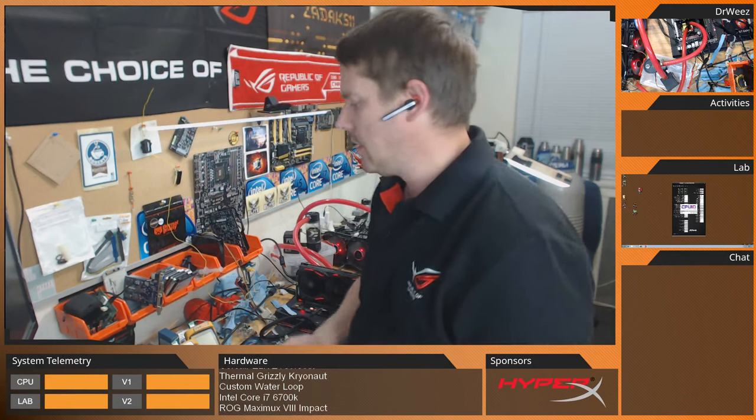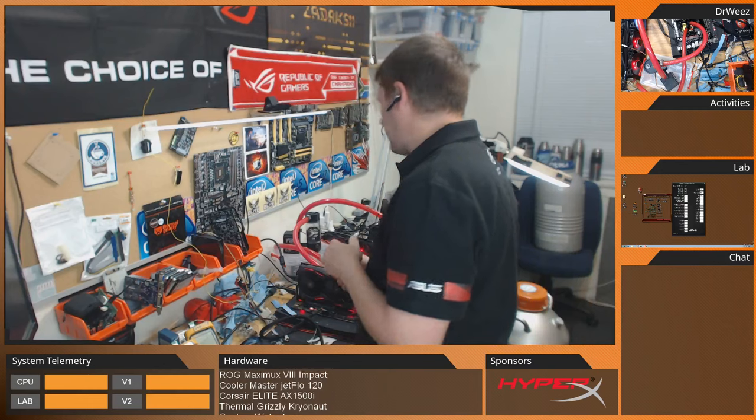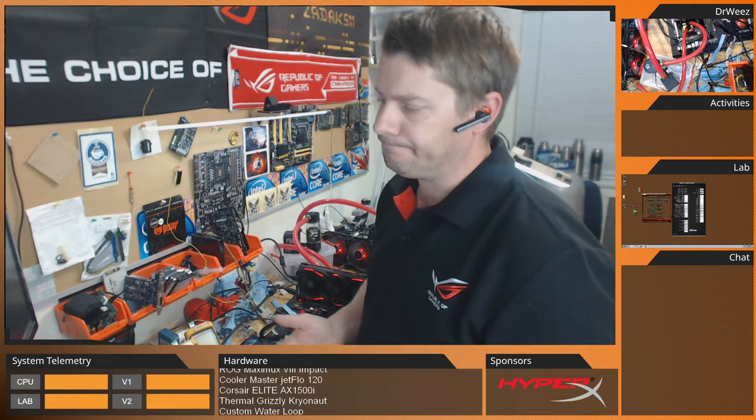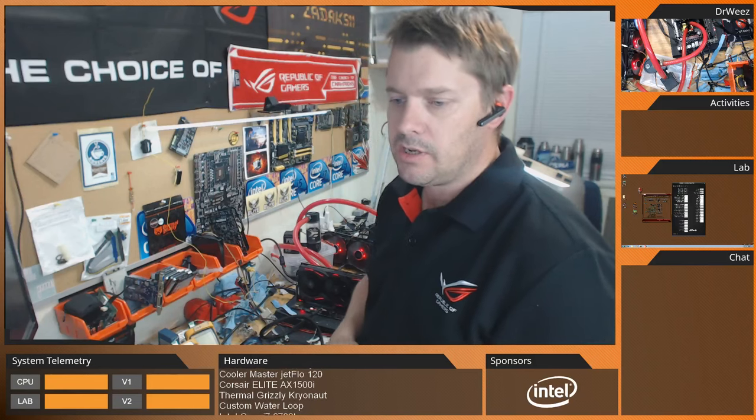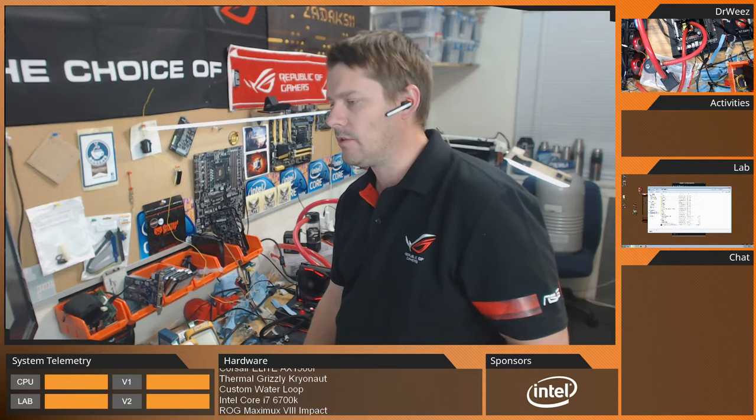At the moment, let me just go through and show you what we've got set up on the board so far. Like I said, I have been only playing with memory timings this afternoon, this evening. You can see that I've got nothing set on the processor, and the memory I've just set to 3466. I've just been playing around with some of the secondary and third timings a little bit. It is all on air, so you can't expect to get the same out that you would on LN2 with a cold IMC. Some of the crucial things to say is that I haven't touched any of the voltages, so SA voltage and all of that sort of stuff is still stock standard.